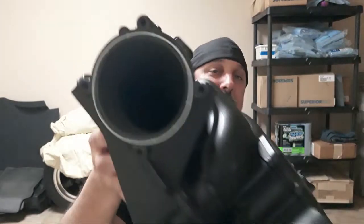I'll take that a step farther. If you're going to go with a ported throttle body, the 84 is about as big as you can go, 84 to 85, but you really won't get that much out of it unless you've got your manifold ported. I know this because, as y'all know, getting to be that time of year, I just got through porting this thing. So I can tell you exactly why that throttle body just really won't help anything.